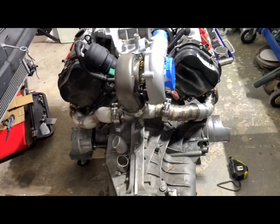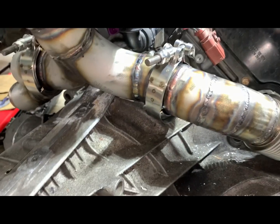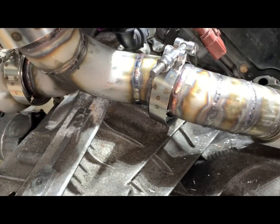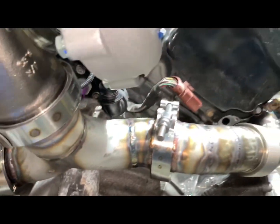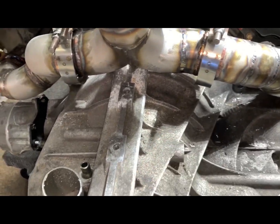Before, was everything perfect? Perfect. This gate — we've got to cut it in here and try to make it flow as smooth as possible. The flow goes this way, which means your fitting should look something like that, going into the flow of the exhaust gas. The wastegate will be right in here, a little bit away from the transmission because we have DSG fluid lines.